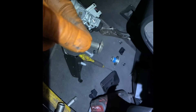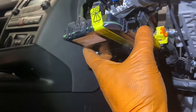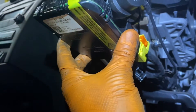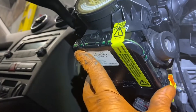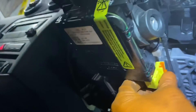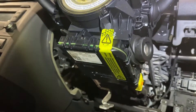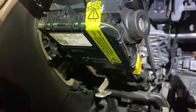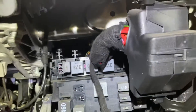When putting the shear bolts back together, I just put a little cut across them with a grinder and run them in with a flat screwdriver. Shear bolts in and up we go. I'm not going to connect the external block connectors just yet, but it should all go back up relatively easily. The base plate is on, and the external block connectors are back on. The little size 8 torx bolt goes back in the front, and then I'll drive a couple of bolts into the steering column. Torque settings for the four steering column bolts are 45 Newton metres plus 90 degrees.